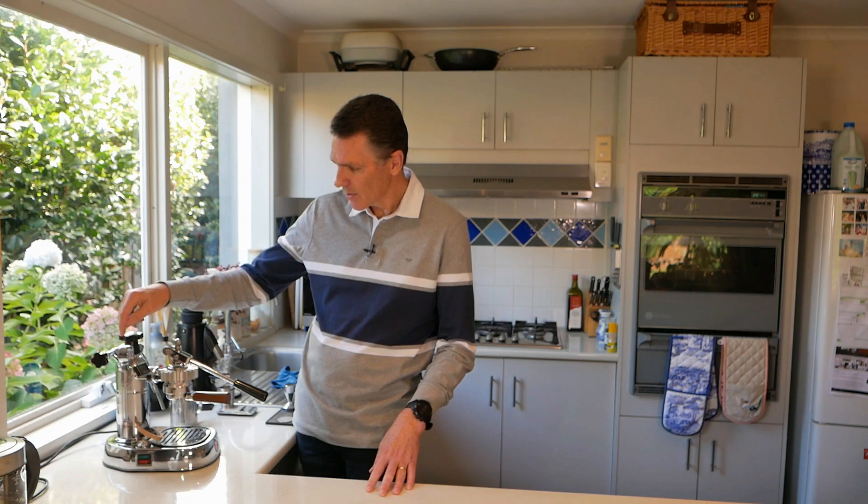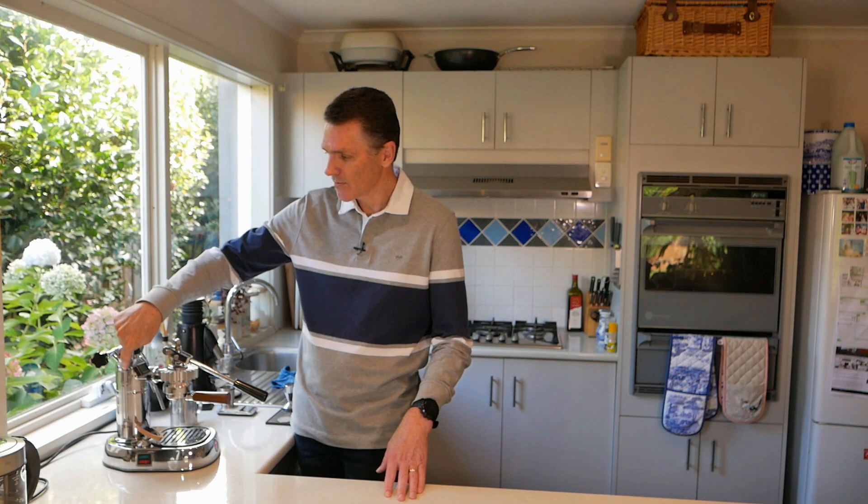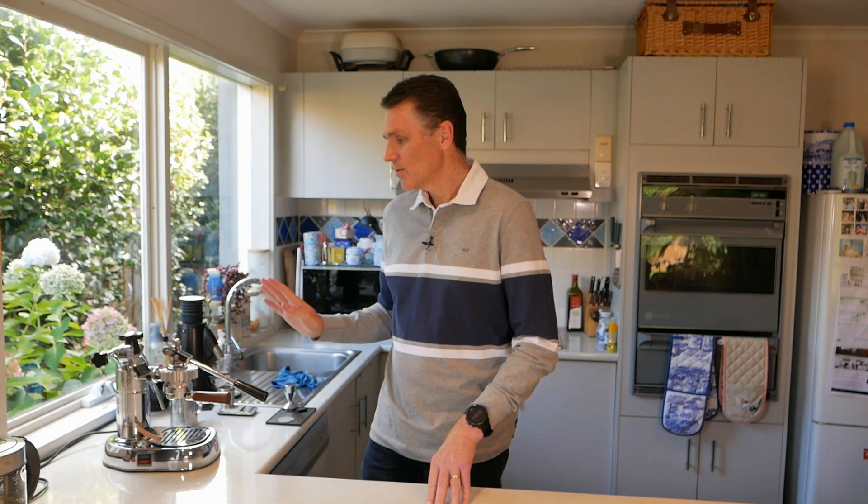It also doesn't have a pressure gauge for the boiler. I bought a pressure gauge and honestly it was the simplest thing to install — just screw off the little screw at the top and screw the pressure gauge in, and you're done. You can even run it without a pressure gauge if you really want to. So really, the big issue is the boiler capacity.